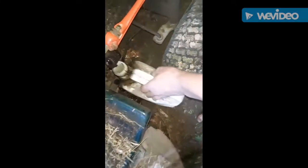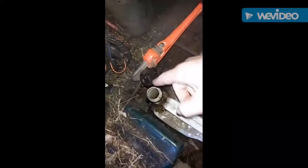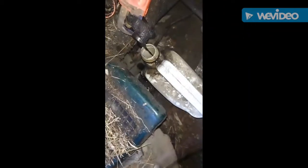This is gonna get kind of messy. What you can do with this little pipe is face it straight up. I didn't have to turn it over at first because the oil was just pouring out — there was a lot of oil and gas mixture in there. A gas lawnmower shouldn't have that mixture; that's why it was smoking so much. Just turn the pipe to where you need it and let the oil drip into your pan.